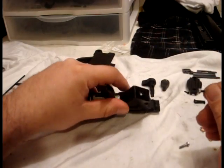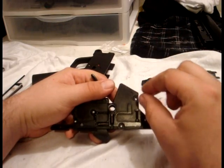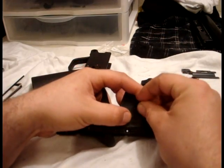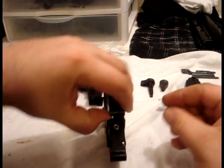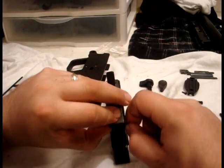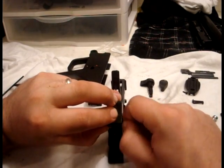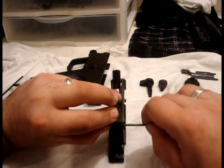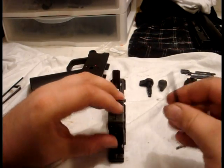We can repeat the process of attaching the nut to the screw, sticking it in the indentation. These are a little trickier because they're open-sided. Flip it around, and make sure that that nut is flush on the back side when you start screwing it in. Otherwise you can tighten down the screw and the nut can be loose, so the screw is actually not tight.